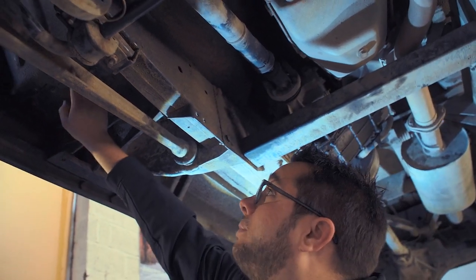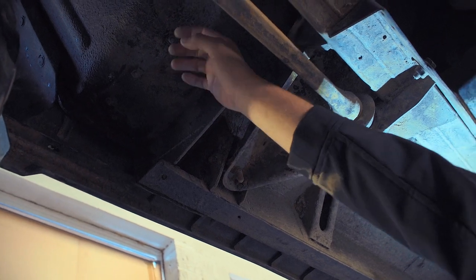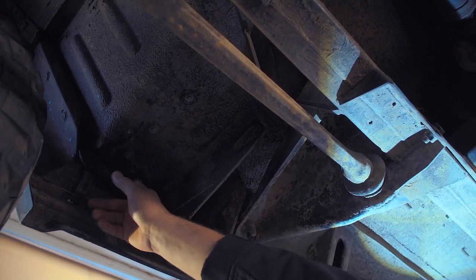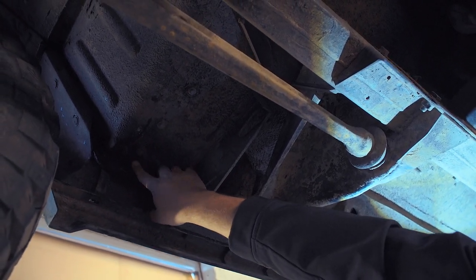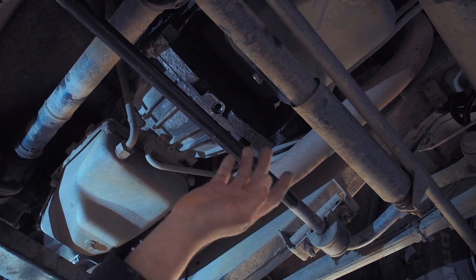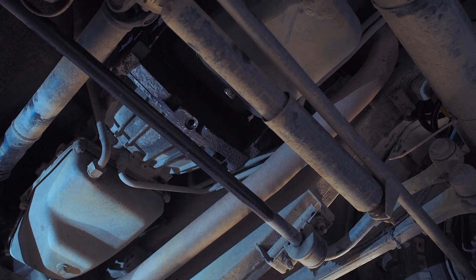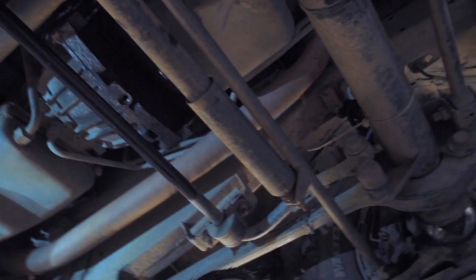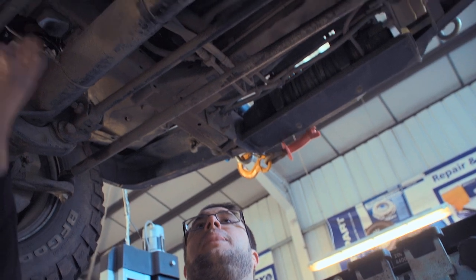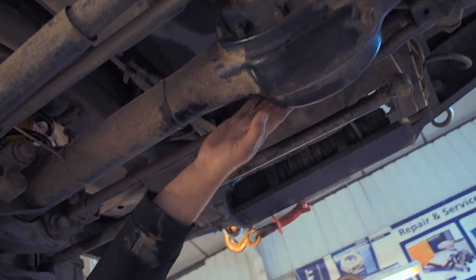Going further forward, check the floors in the front footwells. If the vehicle has got sunroofs there's a good chance the carpet and sound deadening will be sodden with water — that's what rusts the floors out, so give them a good poke to make sure there's no excessive corrosion, as that's quite a big job to repair. Check the engine for oil leaks — a bit of staining and light covering of oil is normal, but if there's anything really pouring out take that into consideration. Right at the front, check the steering drag link and track rod to make sure they're not bent and check for off-road damage to the front differential pan.